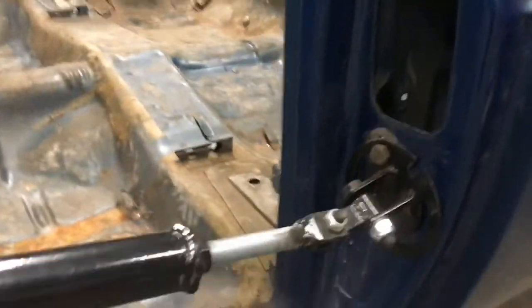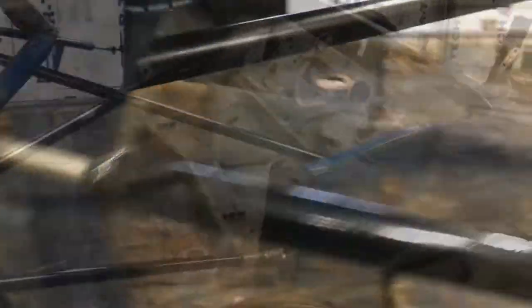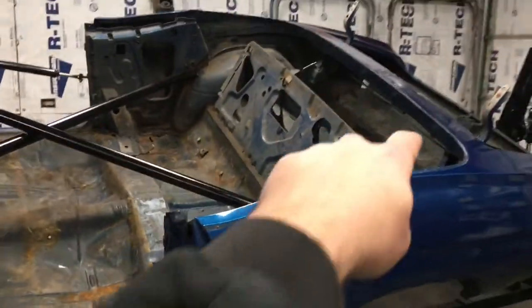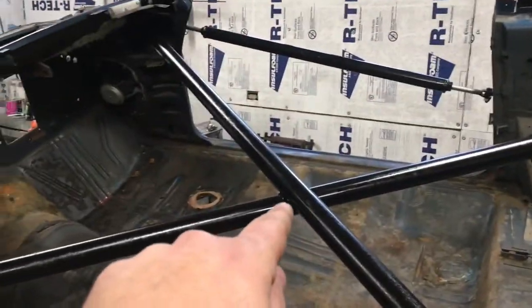Now when setting it up for the rotisserie, you want to take the doors off and actually install these door bars. They're adjustable and they can go to the factory mounts right here on the striker, right here on the hinge. Now since this car is a convertible and it doesn't have the support of the roof, we actually took some steel tubing, cut it to length, and tack welded it in all the corners and in the center here.